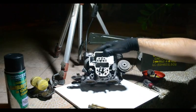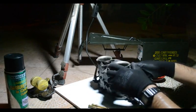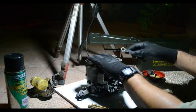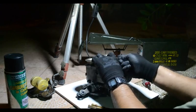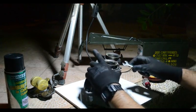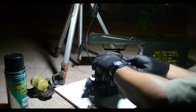And you'll see this now, this is going to spill. Whatever little gasoline is inside the carb is going to spill out. Then, and I don't know if you can see it in the video, but you can see a good amount of dirt on the mouth of the air horns. Next is we take off the air horns, because this is what has the, these are hard to get off sometimes, this is what has the throat of the carb, and this is really what gets a good amount of the dirt when the car is running.